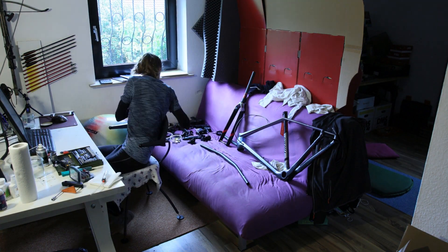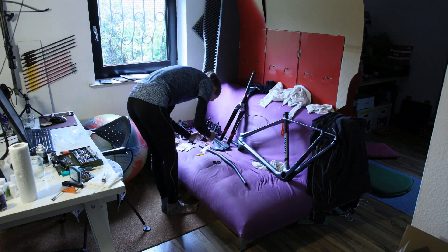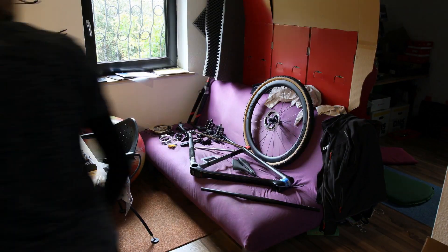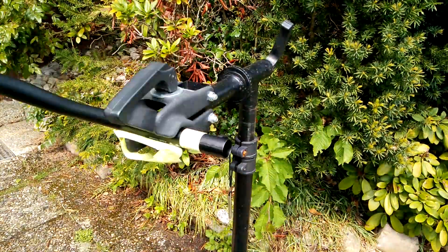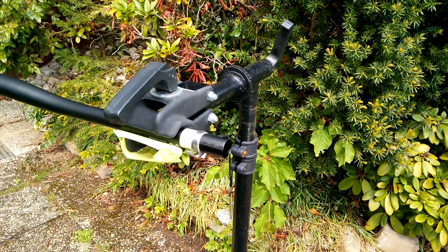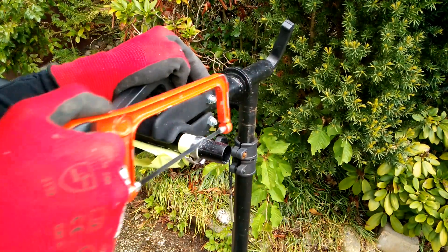The wheels were equipped with the new Shimano XTR brake rotors in 160mm both front and rear, and I upgraded the DT Swiss freehub from 18 teeth to 36 teeth. I would have preferred a 180mm rotor up front for more brake force, however this is only possible by using a post-mount brake caliper with a fairly unsightly adapter.